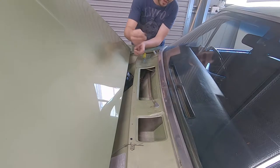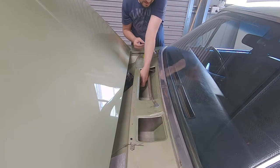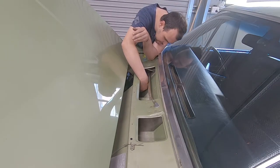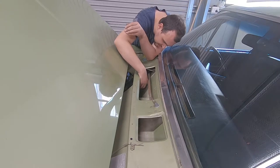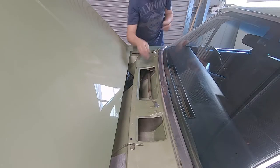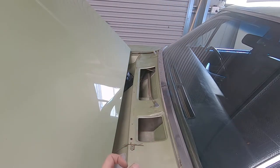This is by far the most fiddly part of the job: getting the clip back on the wiper motor. Actually, getting it on is pretty easy — I think getting it off is harder. Easy as. Have a look at the play in this compared to the other one — there's absolutely bugger all. Whoa, that's exciting! That means we might have solved the problem. Let's get this scuttle panel back on, the wipers on, and give it a test.